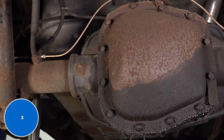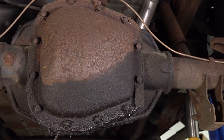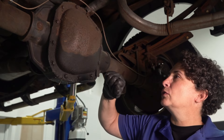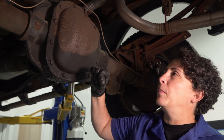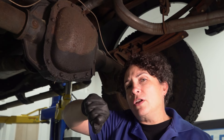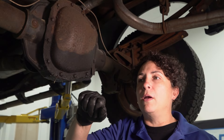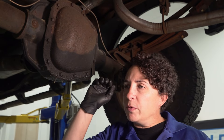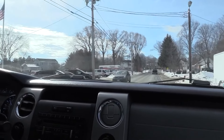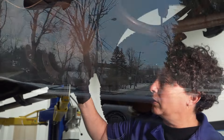Number three. We're way back here at the differential, and there's a reason for that. These puppies like to howl. There is a technical service bulletin on them, and it calls for rebuilding them with a new differential bearing kit. If it makes that noise — whether you're turning slowly in a parking lot, hearing a howling from the rear diff, or after driving on the highway for an hour — the clutch kits are all getting replaced because there's an update on them.